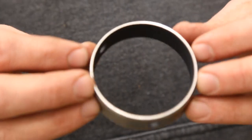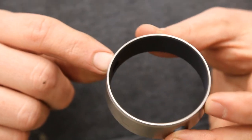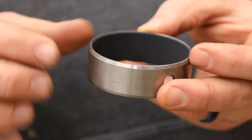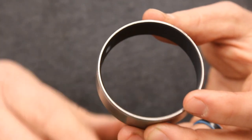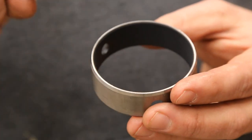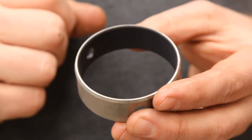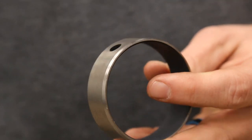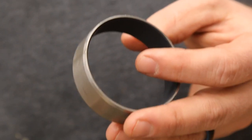This is the replacement bearing — a genuine GM part. This is the third design, number one and number five bearing for Gen 4 engines. Same diameter, just narrower for the rear of the block. Most LT engine builders are actually using this bearing instead of the factory wide bearing with the half moon cut. You just line up the oiling hole and you're good to go, and you don't have to waste money on a $50 bearing that ends up having weird wear anyway.